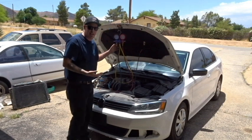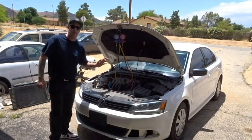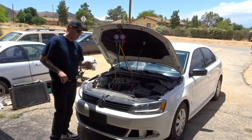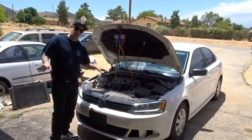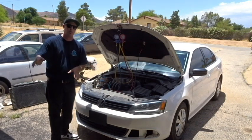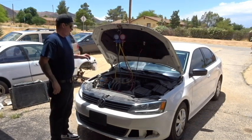So we do have at least 100 PSI worth of pressure with the vehicle not on. The instruction book for the Mastercool tool says that with the vehicle not in operation, you should have at least 50 PSI in order for this tool to work successfully — which we do.